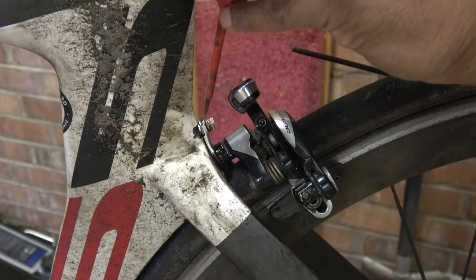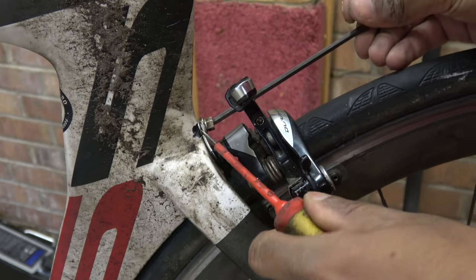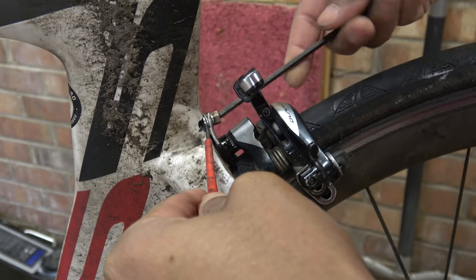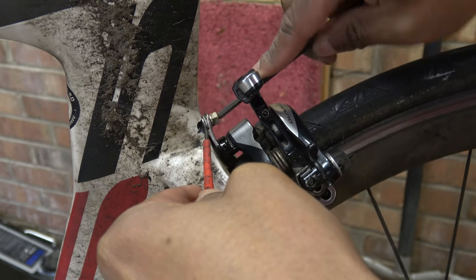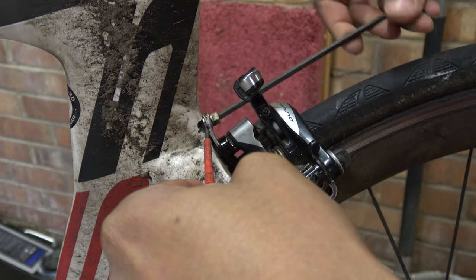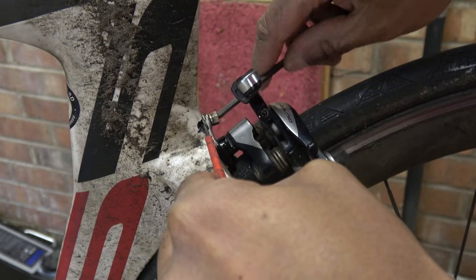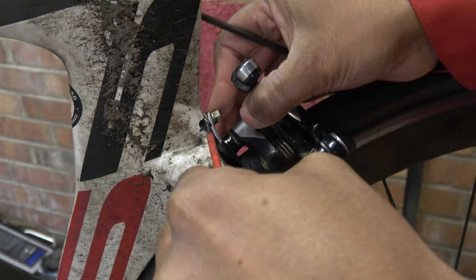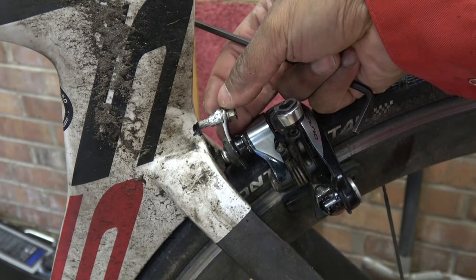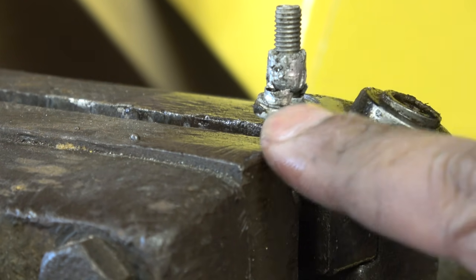Failing that, we need to go for a screwdriver. It's turning, so we need to wedge something into there. I've got the rivnut kind of halfway out and we're just turning this — hopefully it'll pop out. The back of the rivnut is completely loose. As I've pulled it out, the rivnut has actually sheared in half, so I've ended up with half the rivnut in there and half of it out. This is the bracket from the bike and you can see the rivnut snapped in half.